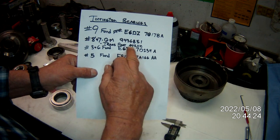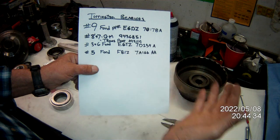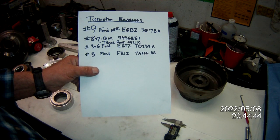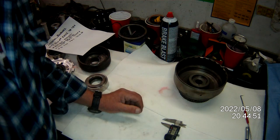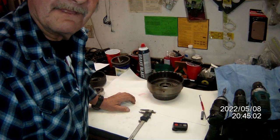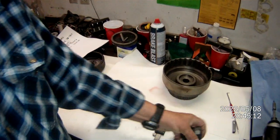This GM part number — you go and look up this trans part number and you'll come up with five different numbers from different suppliers, but they're all exactly the same bearing. Positions three and six are the stock ones — every C6 has got those bearings in them. That was rollerized by Ford back when they first designed and built the transmission. Got any questions, leave them in the comments. I try to do the best I can. Hit the like button, please subscribe. Good night all.